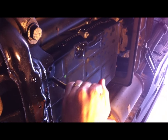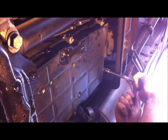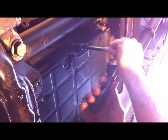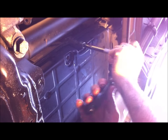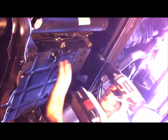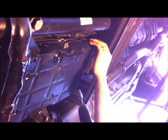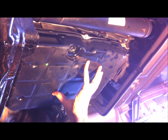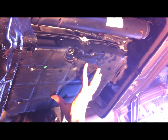Now we're starting to remove the oil pan by loosening the six bolts with an E10 Torx socket. We've loosened all the bolts and now we're just going to run out the back ones with the cordless drill. Take the little bracket and nut out. Keep your left hand on the pan because it will start tipping downwards at the rear.